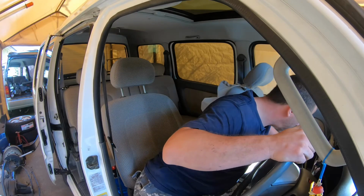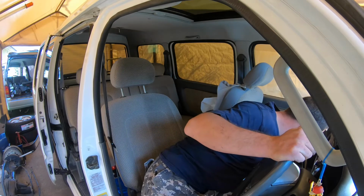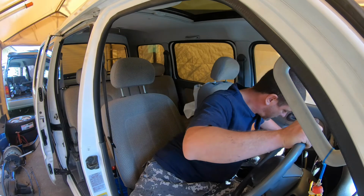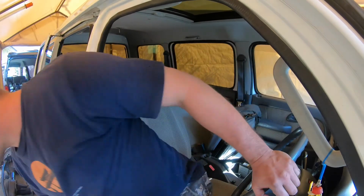Now my theory here is maybe it is actually temperature related. So there's an airlock, maybe something like that. I'm all out of ideas, grasping at straws. Let's try bleeding air out of the coolant system, maybe. I know I keep calling it the water, but it's coolant. Now pop the hood. We'll do the hood one as well.